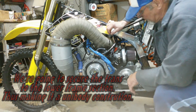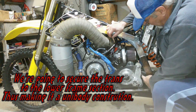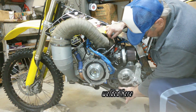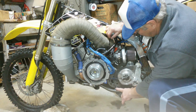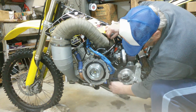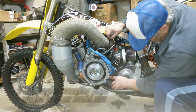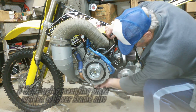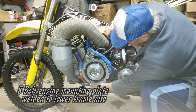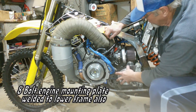So we're going to end up changing our mounts on the box here. We're going to put a shaft through here for the swing arm, and weld this shaft and the box right to the lower frame on both sides. We're going to put a plate up front to catch these two rear motor mounts, and then weld another plate to catch the four motor mounts underneath the motor, welded to the frame in the front section. That will be one solid piece all in here.